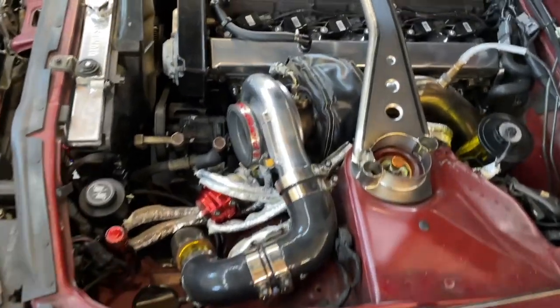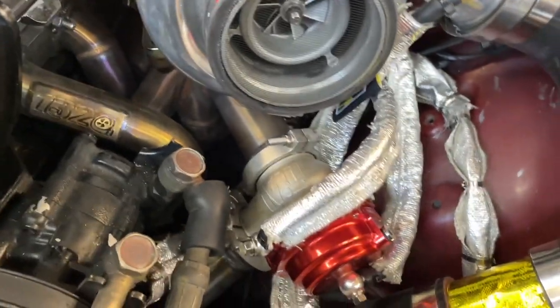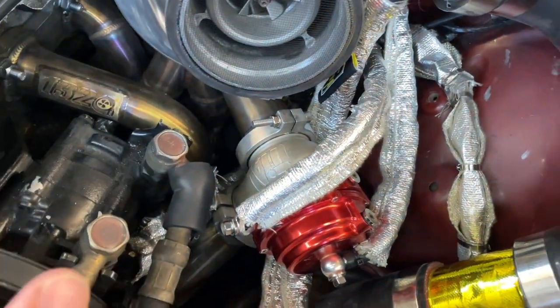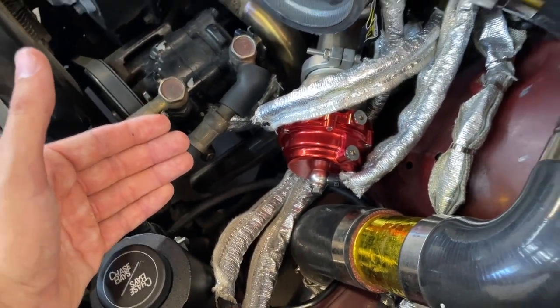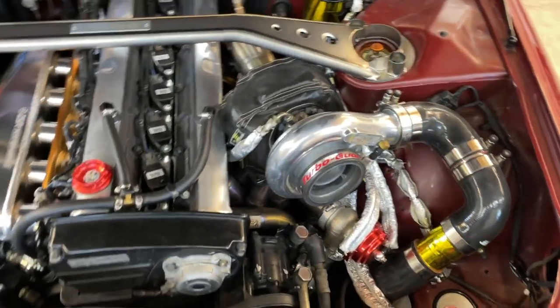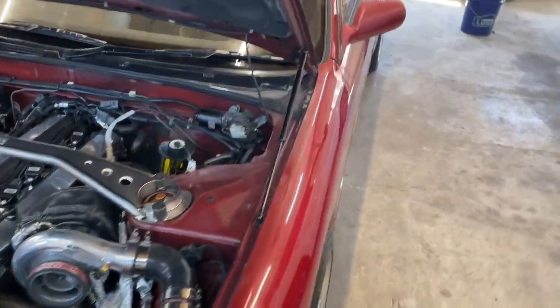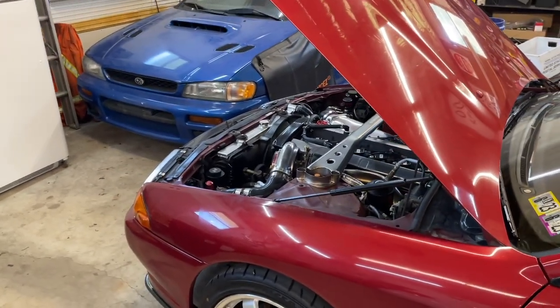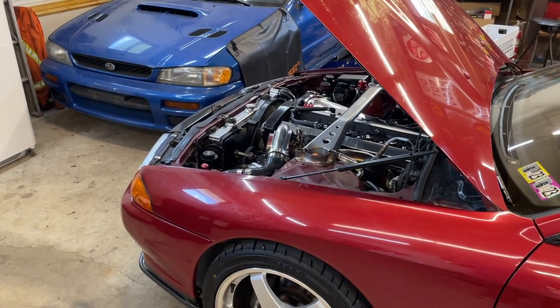Just an update: if you can hear air coming out around your flanges on your wastegates, or you can put your hand underneath the dump tube while it's idling while still cold and feel air coming out, something's not right — you've got to fix it. You're giving up valuable performance. I want to pull up an old log from before I fixed this problem and compare it to now — I guarantee it's a slower spool up and we might not even have the same boost pressure.